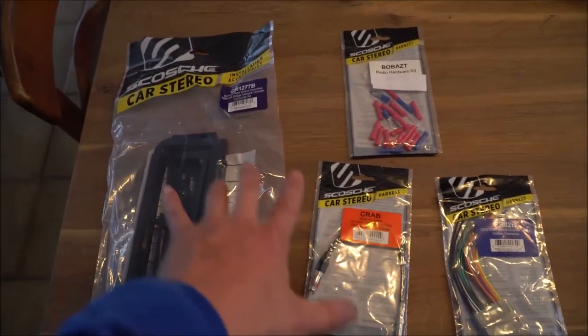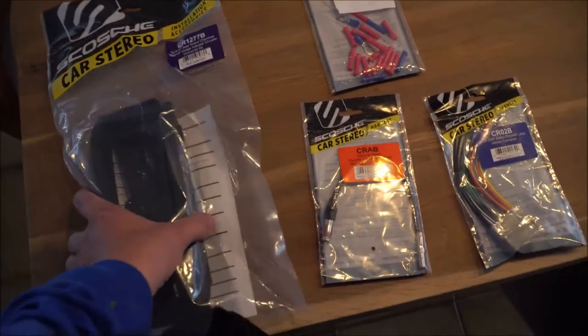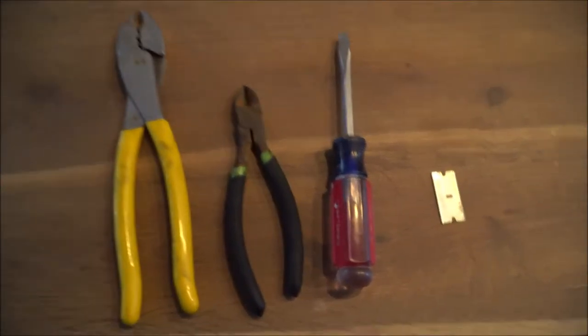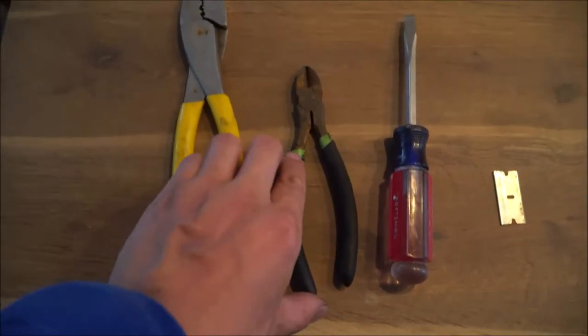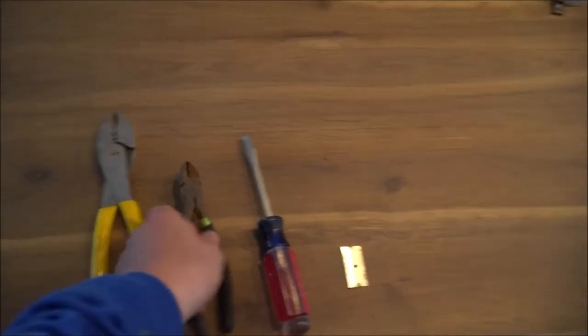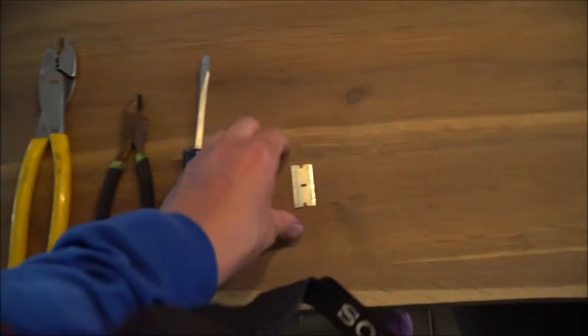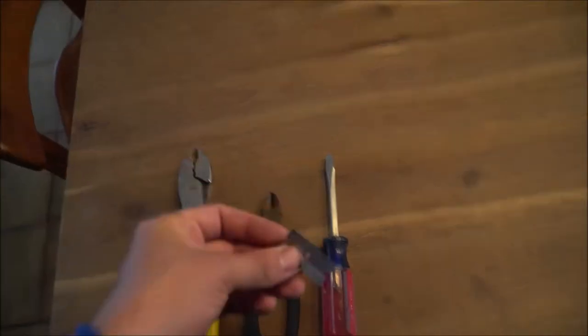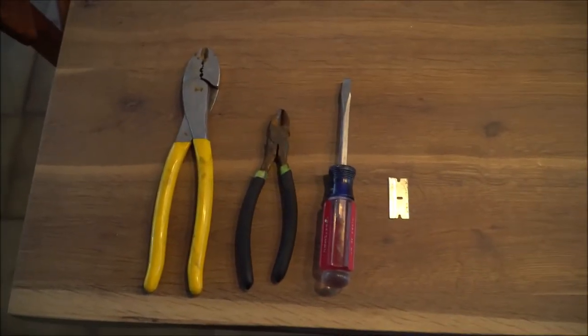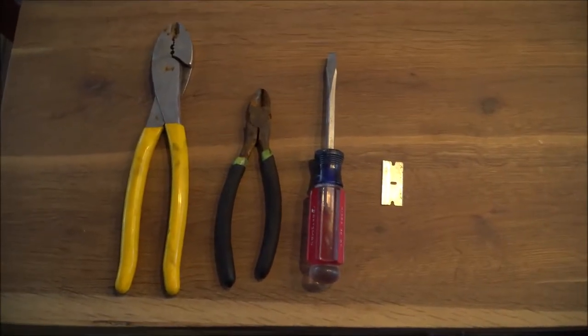So that's what you need hardware-wise to install the aftermarket radio, and of course the aftermarket radio itself. I'll show you what you're going to need tools-wise. That's all you need: I got a prying tool, also known as a flathead screwdriver. I got some dykes, just some cutters — you can use scissors if you like, but these are much sharper. And these are crimpers. So: a pair of crimpers, cutters, prying tool, and this is what I'm using to strip wire because I couldn't find a wire stripper. I'm just going to use this blade and show you guys how that's done.